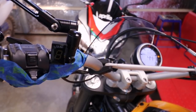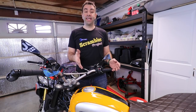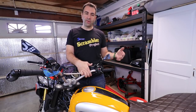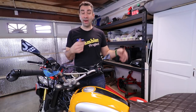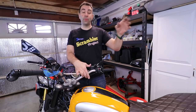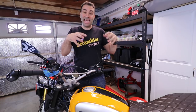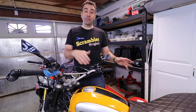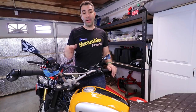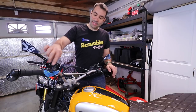Wait until sixth gear shows zero — at that point the sequence is completed and you're good to go. Now that the gear indicator has been set up, which is a weird procedure in a garage because you've got to run through all the gears, just remember one thing: leave one of the doors open so that the exhaust has somewhere to go rather than staying nearby and you passing out. Once the procedure is done and this thing has learned gears one through six including neutral, it's time to remove the masking tape.